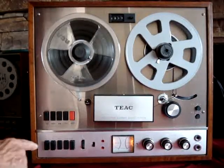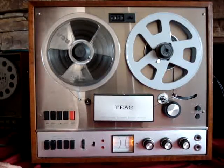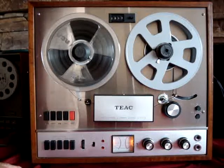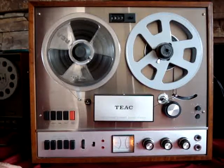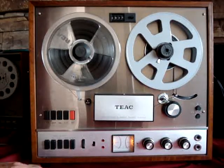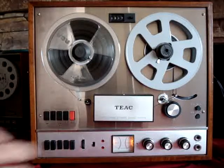When you're recording you can also use either A or B alone — you don't have to record in stereo. If you want to record something like a baseball game that's three and a half or four hours long, you can get a lot of recording time by just recording on one track. This is an automatic reverse machine, so you can actually record on four tracks — two channels in each direction, like a four-lane highway with two lanes going each way.